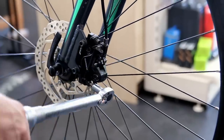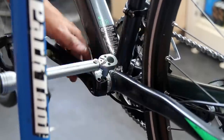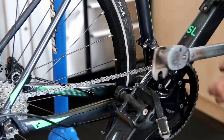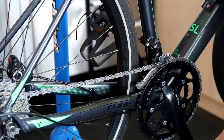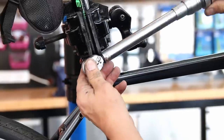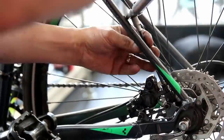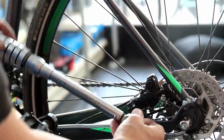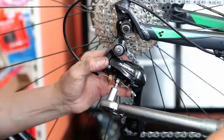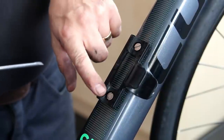Now I'm working my way through the bike with the torque wrenches. We've got three or four different torque wrenches for different jobs and we gradually work our way through checking all the torques and specs — every nut and bolt we can readily get to. Saddle clamps especially — loads of those are off and loose. We've got various different lengths and fittings to be able to breeze through.